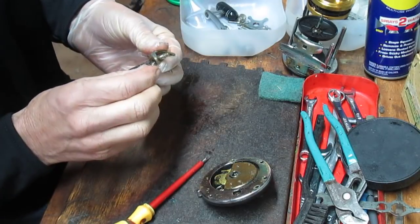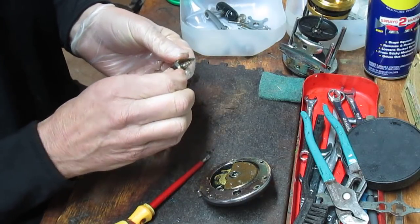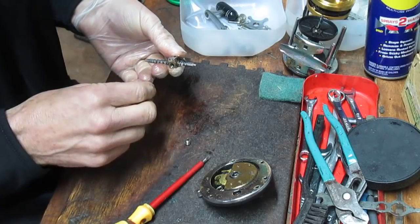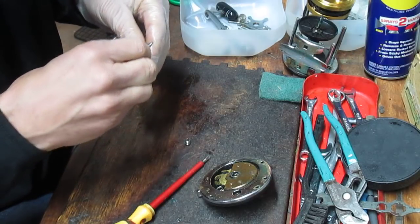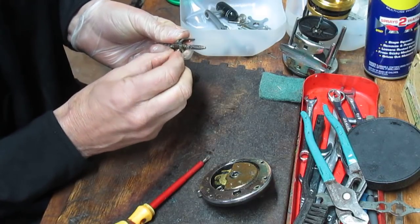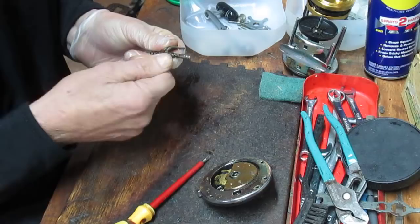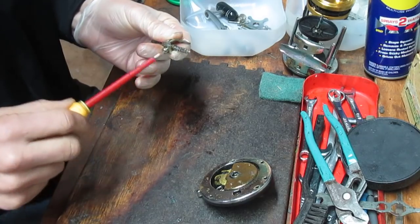Once you've done that, you're going to reinstall it back into the carrier assembly. Again, it's a screw, and you have to be a little bit careful here. That's why. The fork rides through. Just want to make sure I have it on the right side. I didn't. The fork rides through on that, and then it seats itself in that cross hatching on the gear itself. So if you don't screw this in properly, what will happen is the pawl won't sit correctly, and the gear won't function the way it's intended.